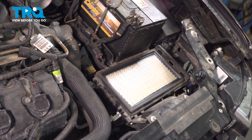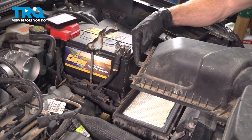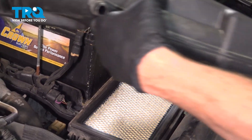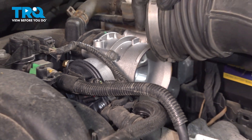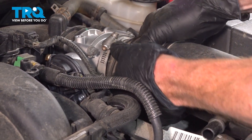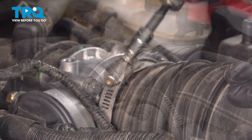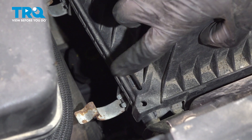Install your air filter. Now we can move along to the upper air filter housing and air inlet tube. When you go to install this, make sure you have your three mounting tabs aligned with the corresponding slots in the lower housing. Now align the air inlet tube with the throttle body and bring this down into place. Make sure you press this all the way up against the throttle body and tighten that 8-millimeter-headed clamp so no dirty or unmetered air makes its way into the engine.